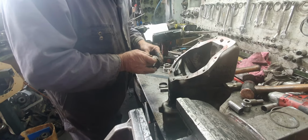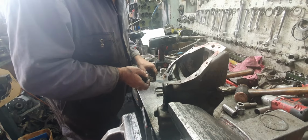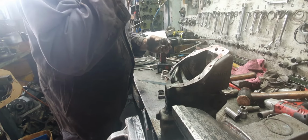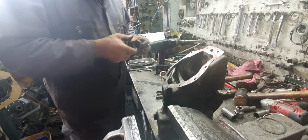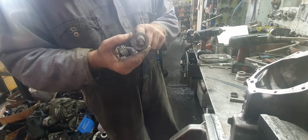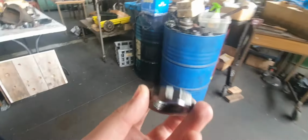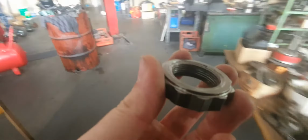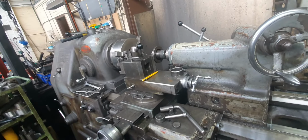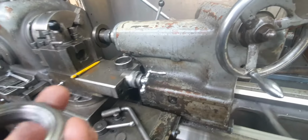That's all there is between them, you see. Just put that in the lathe, blow the chuck in, give them, I think it's 1.5mm. See, it's got Loctite in it now. Yeah, I'll get it out. Just stick the thread file on it, see? Yeah. Now, I think that phone of mine was over here. The 3-jaw chuck, yeah? It'll hold in the 3-jaw. Okay. As I say, blow the scroll out.